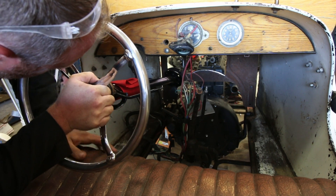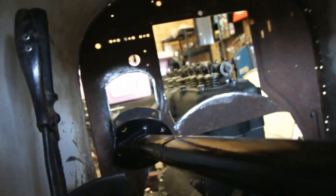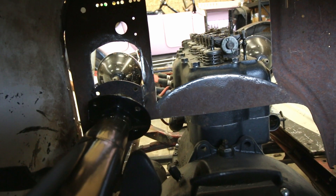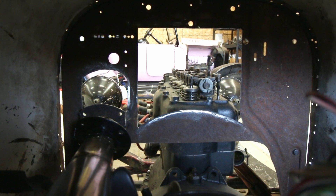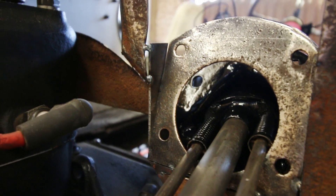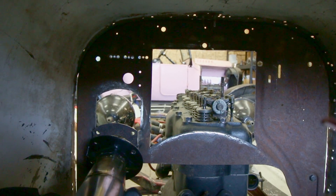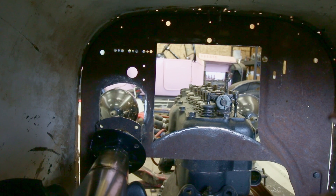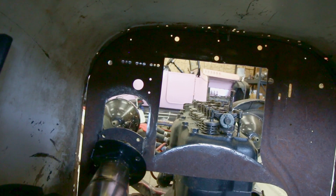Well, I forgot about that — we need to make a round hole fit into a square peg. It's easy to sometimes not see the error of your ways, and I wasn't thinking. We've got a round flange that I just turned into a square hole. I actually did scribe out a round flange on the metal there, but I was like, nah, I don't need to worry about that. Well, guess what? I did. Got it squared off there and it's rounded back in there. We'll chuck this thing up and cut off the ends of the steering column there, make it more like a '26-'27. We don't really need those huge flanges on there anyway, because it'll be supported without them.